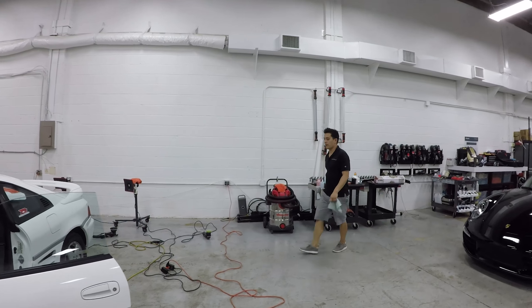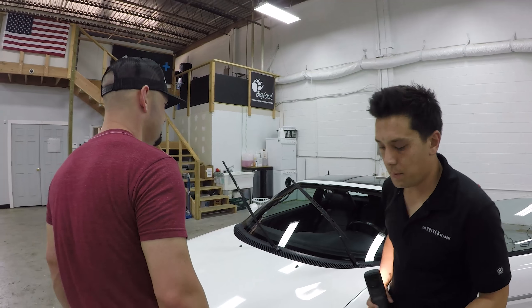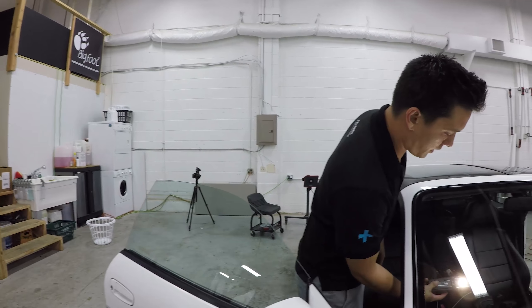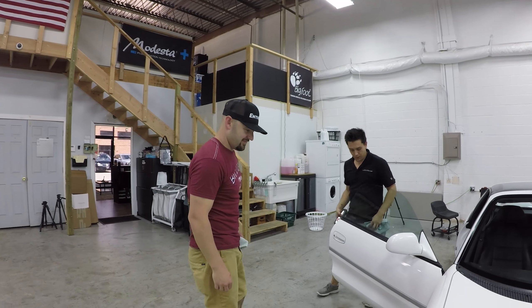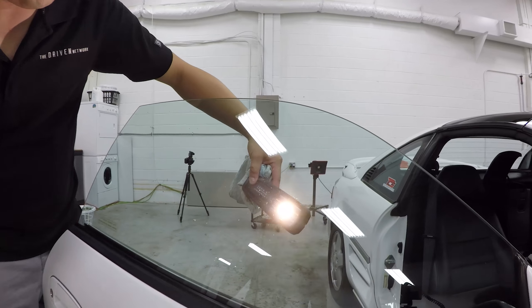How's it look? Looks good. For me that looks crystal clear, but then I'll get it out in other light and think oh, it doesn't look right. Fluorescent lights versus other lights don't really show marks off the glass well. To really see how your glass looks — like your windows here, this one's dirty, you can see all the smearing inside. Use a light inspection to check your smear marks. You can see glare through this — check to see what you have in glares. Obviously you have wiper marks that happen over time. The only way to truly see this is if you're outside.